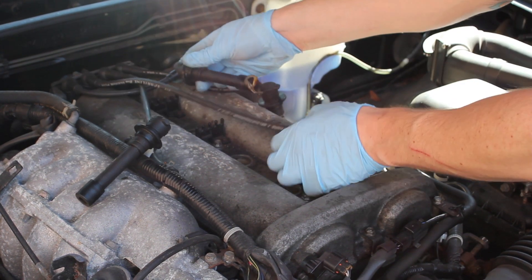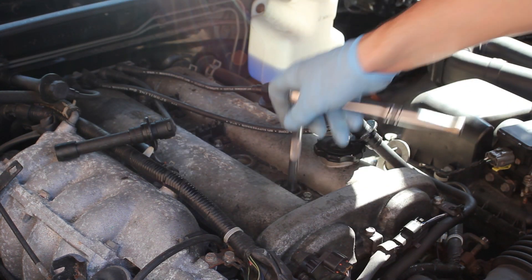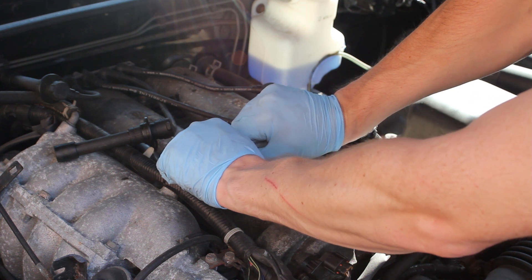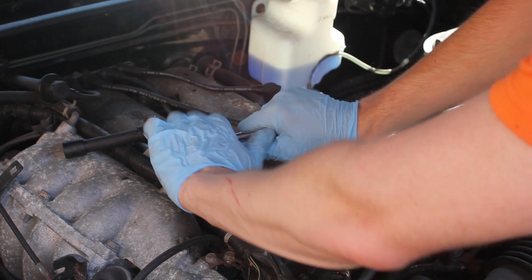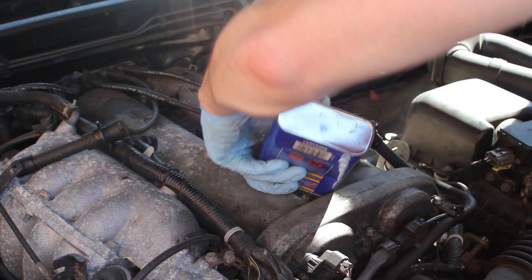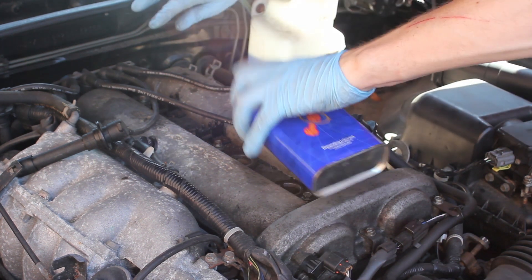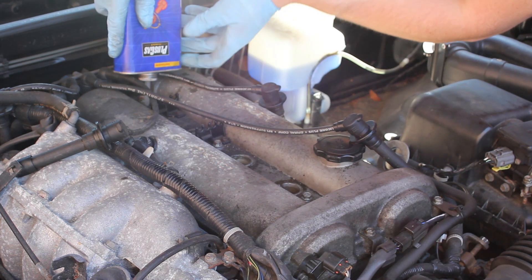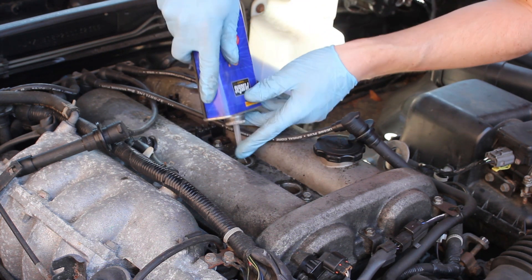Unfortunately I had a bit of an issue with this. Just previously in the afternoon I changed all eight of my wife's Honda Jazz spark plugs using the same socket and extension. With this it just wouldn't undo. I wanted to illustrate how much effort I was putting in — this really was too much effort. I tried soaking with plus gas overnight to loosen things, and also got the engine right up to temperature, but there was no joy. In the end a friend suggested using a breaker bar with slow even pressure.